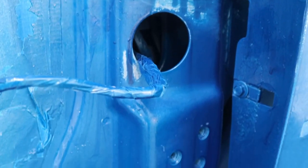Right, we've sanded all those runs out there and I've just gone round. I found a little bit down there, so I've sanded that back and I've just worked along. I've given it all a little gentle rub down just for the next coat to key better.